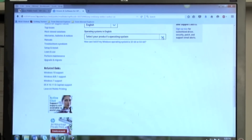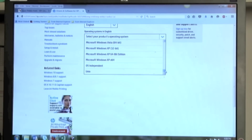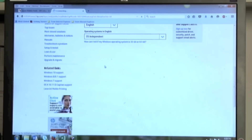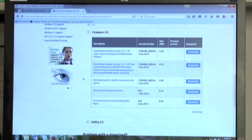I've got Windows 7 Professional 64-bit and I can click on that. I do want to stress that sometimes you click on your OS and you don't find firmware listed there. What you can do is scroll down to the bottom where they often have something called OS Independent — it doesn't matter what your operating system is. A lot of times you'll find firmware there when you won't find it elsewhere. Here's our firmware, and I've also got the README file, which tells me the fixes and all the different methods to upload firmware to this device.